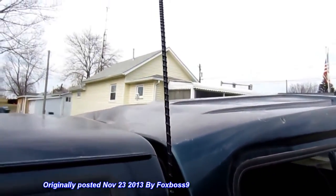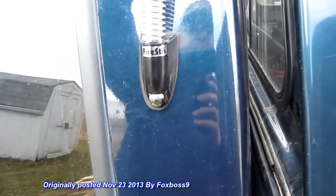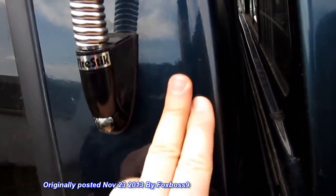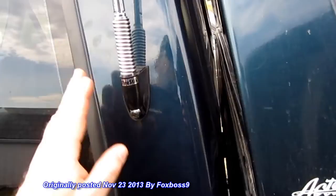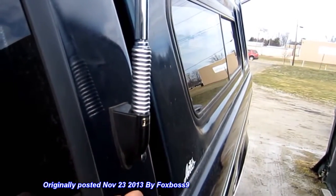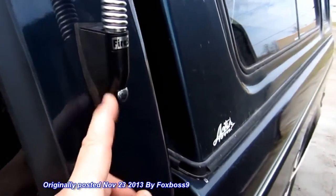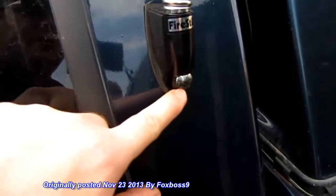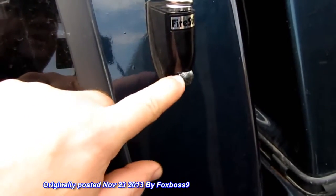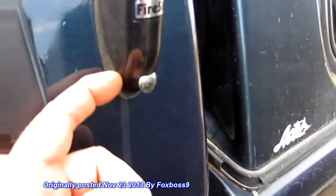I put it on my side of the cab of my truck and it's moving very little. If I were to place it again, I would probably put it back here a little closer to the support on the side. I trimmed this down because it's supposed to be flush vertical, and I trimmed it down so much that I cut into the support for the stud that was originally there. So I had to put a carriage bolt in here — I notched it so it wouldn't spin, then used a plastic welder to beef it back up inside.